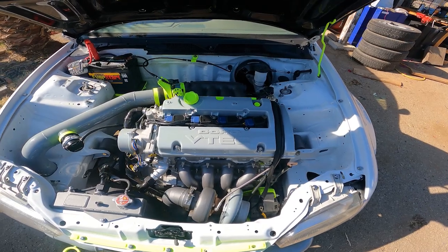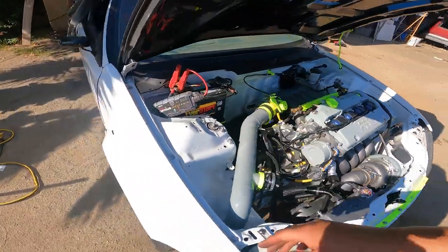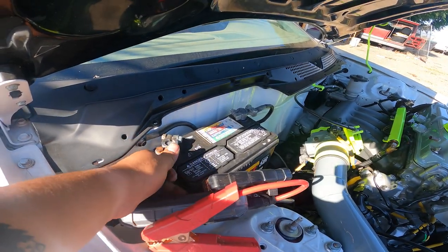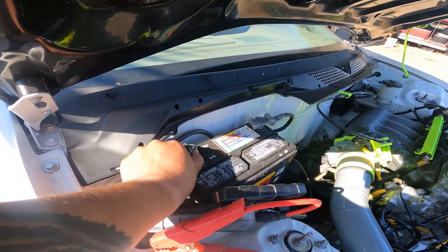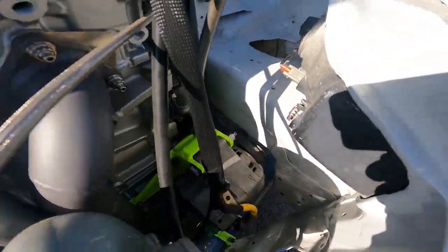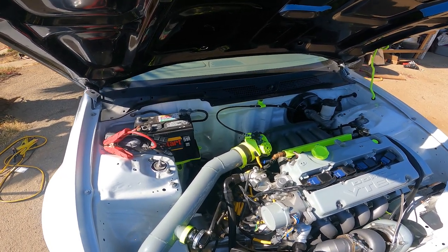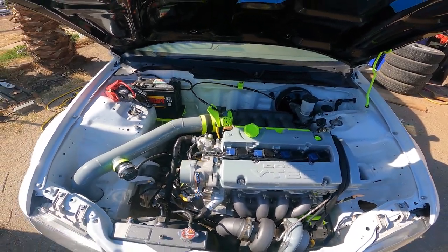That's a good sound — the alternator is screeching, and it wasn't screeching before. This is how you test if the alternator is running: remove the ground or power terminal and if the car stays running then the alternator is working. Yes! Huge shout out to Manny, Miklo82 on Instagram, and Charlie too — you guys were right, the powder coat definitely kept the alternator from grounding properly.